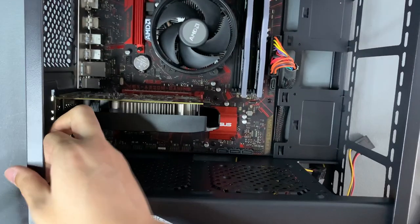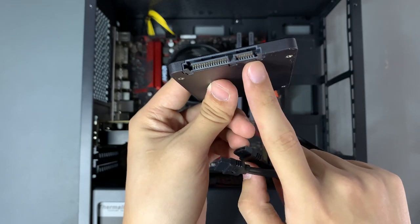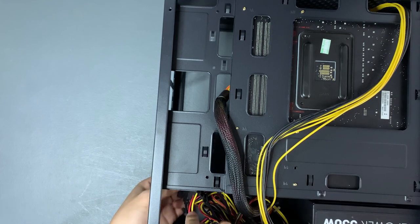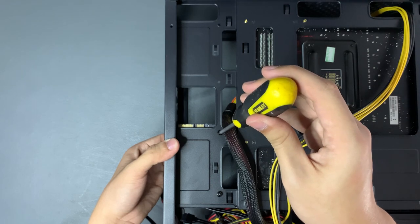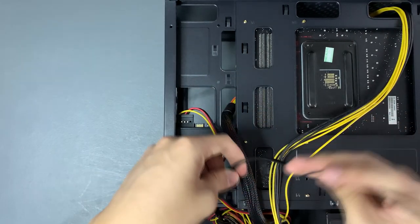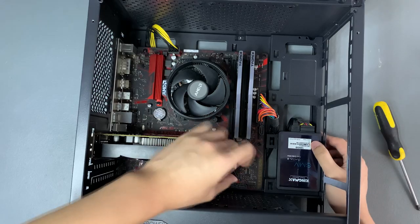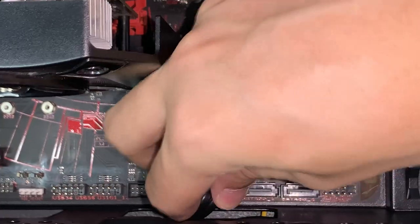Now let's head on to the SSD. We're going to need a SATA cable, which usually comes with your motherboard. This is where the SATA cable and SATA power are going to be plugged in. Experiment with what orientation would be best in your case so that it would look neater and cleaner. Then plug in the SATA power and then the SATA cable, and route the SATA cable to the bottom port where it leads to the SATA ports on the motherboard. Plug the SATA cable into the SATA port on the motherboard and we are almost done.